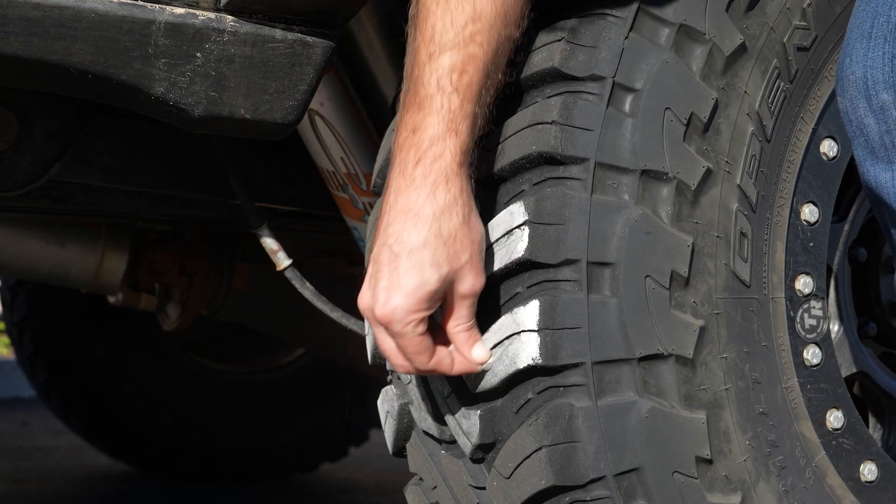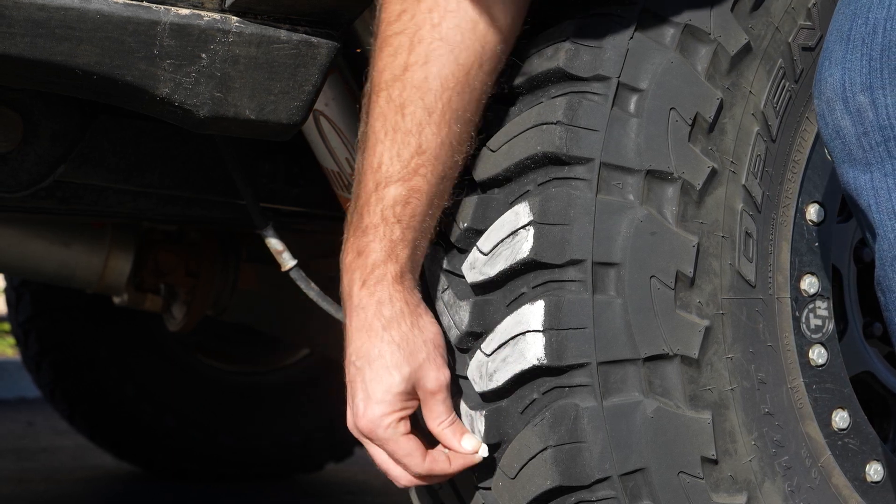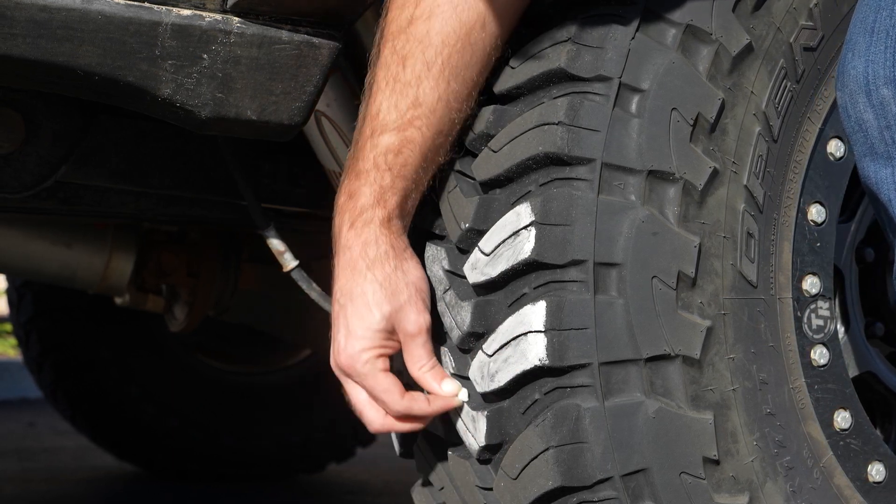For the sake of what we're talking about here, I'm assuming most of you guys are running aftermarket suspension, aftermarket wheels, and aftermarket tires. In an ideal world you would consult the load inflation index and figure out, okay, these are my different pressures and this is what the truck is capable of carrying. You'd take the truck to a dual-axle scale unloaded and say, this is what the truck weighs up front and in the rear unloaded, then again with a full load. This takes a lot of time, it's very involved, and actually can be completely unnecessary — and we're going to show you why.